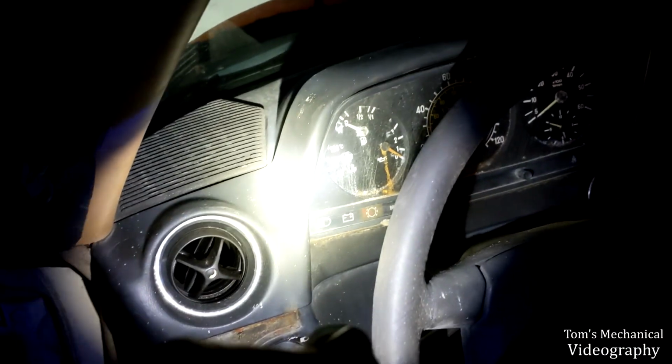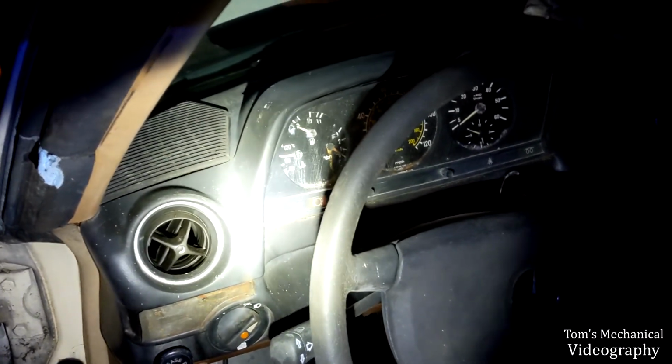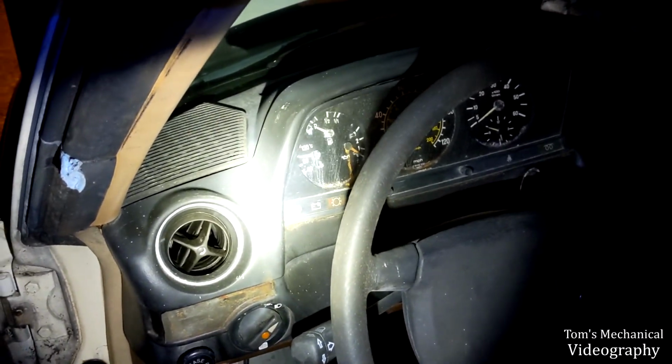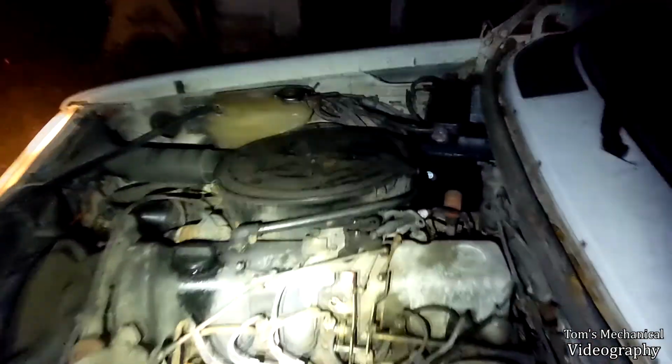I can smell rubber burning, which is probably not a good thing. Probably the compressor belt. Oh, wow. Oh, look at that. Temperature went down. That's good. That's perfect. That's exactly what we want to see. The water pump is working. I just dropped the temperature about 7 degrees with that RPM dump. So we have flow. We have flow. Guys, oh, seizure. We've done it. We've made progress.